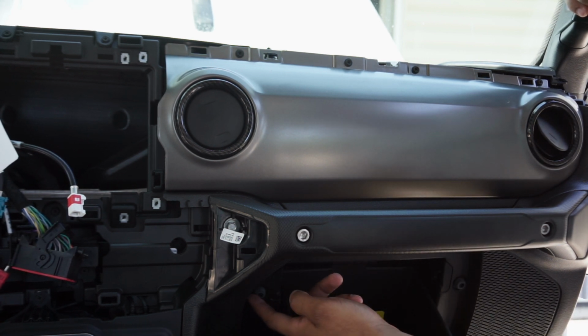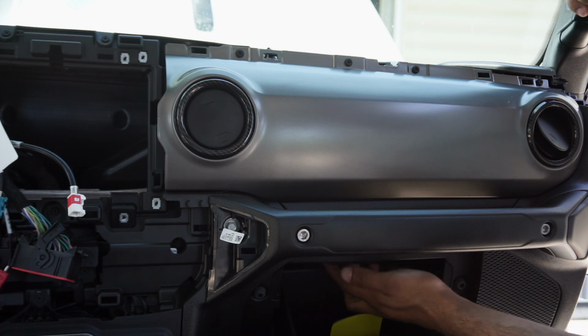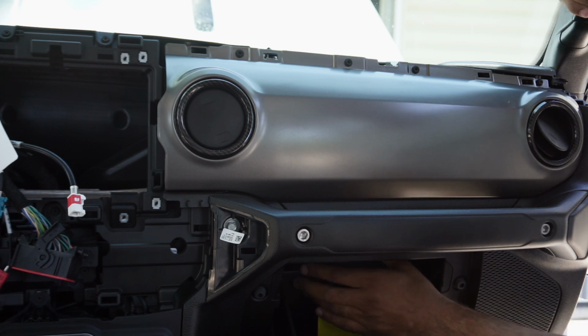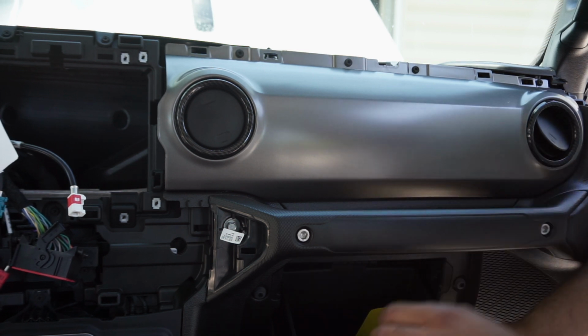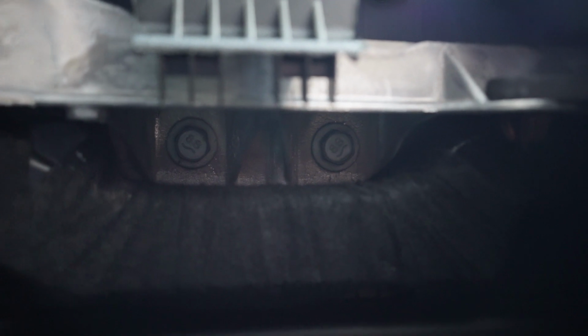straight up, you'll have the airbag plug, and then you'll have 2 bolts that are holding the airbag together, which I believe is a 13mm screw or whatever that you have to pull out to go ahead and get that. So to pull this apart, first you need to take out this first. See, there you go, straight under you got those 2 bolts right there you gotta take out, and then you have this little yellow clip, which is just a snap clip or whatever.